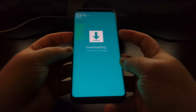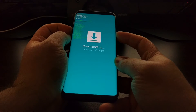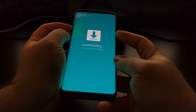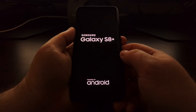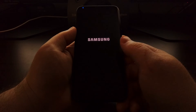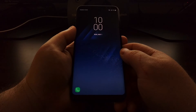To force a restart, press and hold the power, volume down, and Bixby buttons at the same time. Hold these three buttons down for a few seconds and you'll see the device reboot. I'll show you this booting back up into Android so you know that it is safe to boot into download mode and then do a restart.